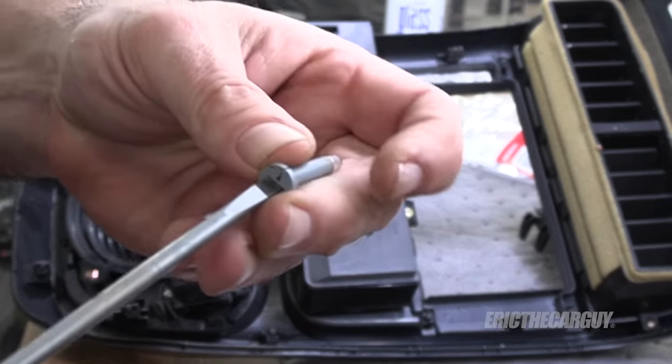And for good measure, I'll check the seat belt. The SRS light on the dash is out — awesome. Do yourself a favor and don't waste an opportunity to keep a good seat belt. Run it all the way out as far as you can, cut it, and take the other end — slide all the bits off it. You can do something similar with this end, just cut it and slide off all the bits you don't need. You've got something you could pull engines with and all kinds of other stuff. This will be an excellent addition to my engine pulling and transmission pulling arsenal. You could also use this to plug into your seat belt buckle — I roll them up like this for easy storage.